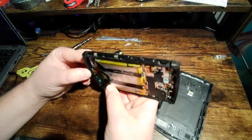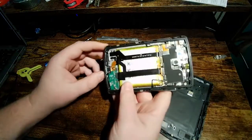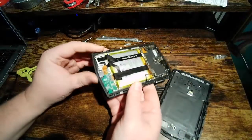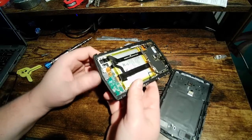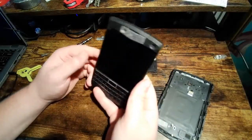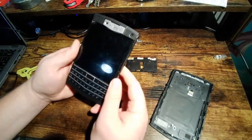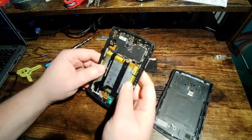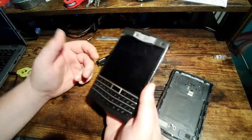The USB port on the bottom is a Jelly Bean off the shelf type deal. They're pretty water resistant, but those rubber bungs I was telling you about up here usually come with one that goes in here too. I use wireless charging almost exclusively on this phone, so I could easily just put epoxy in there and probably be okay. But I recommend getting a little rubber thing to put in there too if you're concerned about water ingress. If you plug up both of those, you could probably submerge this phone for an extended period of time, realistically speaking. Would I do it? Probably not, unless I had to. But I'm not shy about getting this phone wet. Like I said, if it gets dirty, I wash it off like I would wash my hands. So, soap and water, not a big deal.